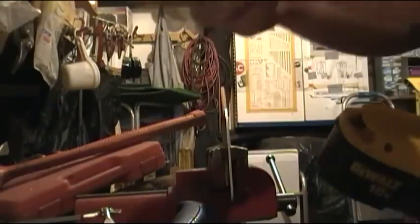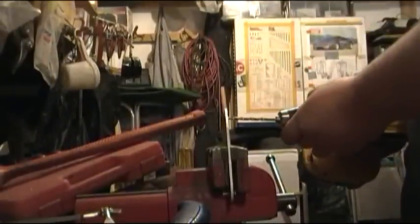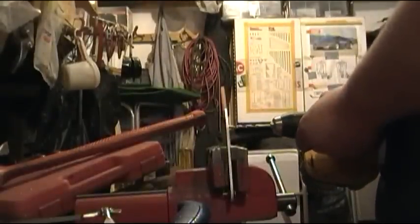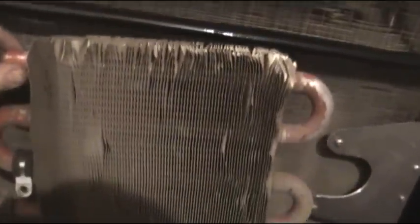Let me change my bit here — just got to drill these two holes out. One... and two. I've drilled the holes and tapped them in the same way as I tapped the others: I drilled a smaller pilot hole and they self-tapped their way in there, both sides. And that's pretty much what those two brackets are going to look like, and the transmission cooler will be up here.